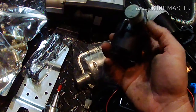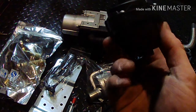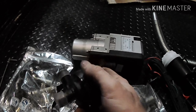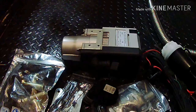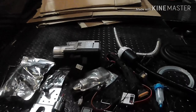There's also a water circulation pump that comes on with the unit and circulates the coolant through the heater while the truck is just sitting with the engine off. You could park the truck waiting outside a school, some event, even sleep in the truck — turn this on. From what I'm reading online this thing burns about a gallon of diesel in an eight-hour period, which isn't bad to keep the truck warm without putting hours on your engine. Anyway, I've got to drop the fuel tank — I'm not going to record all that because if you can't drop a fuel tank maybe you shouldn't tackle this project.